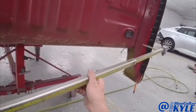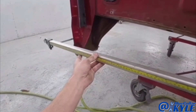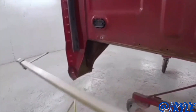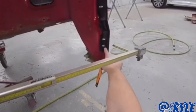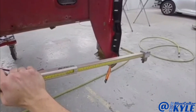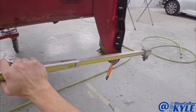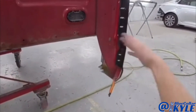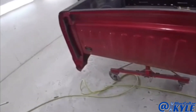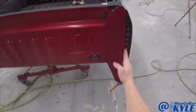I'll show you a little trick I do to make sure the front side of this bed is the same. I exit out, go that direction, then flip it and go to the same spot on the other side. You can see it's almost perfect — it's not an exact measurement, but it tells you this is very close to where the cab corner is going to be whenever the bed is on the truck. I've done these this way many times and it works great every time.